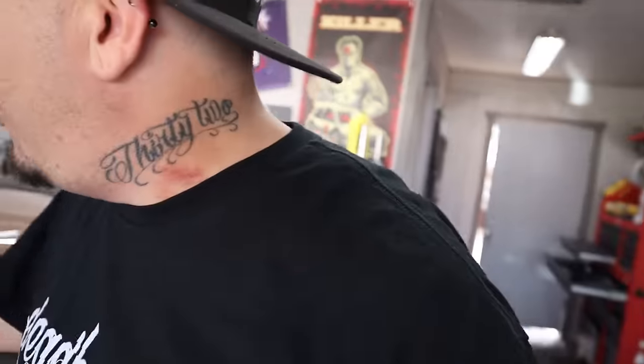Or you basically have to go down to the dealer and have it reset. So whenever you disconnect an airbag, you want the battery disconnected, and you have got to make sure that you do not reconnect the battery until that airbag is plugged back in. So the more you know, man. I'm always working on old 90s vehicles, you know what I'm saying?